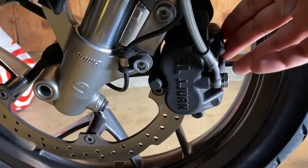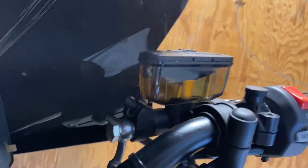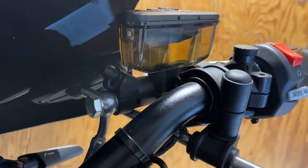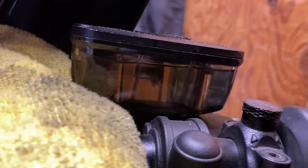The bike is flipped and here is our front caliper. The brake pads still have a good amount left but I'm gonna swap them out anyway. We need to remove a bit of fluid from the reservoir because we're going to have to push the caliper back. There are two Phillips screws on the reservoir. The bike is sideways and it looks like I filled it up to the top, so we're going to have some fun getting fluid out — but I'll get my pump ready and we'll see how it goes.